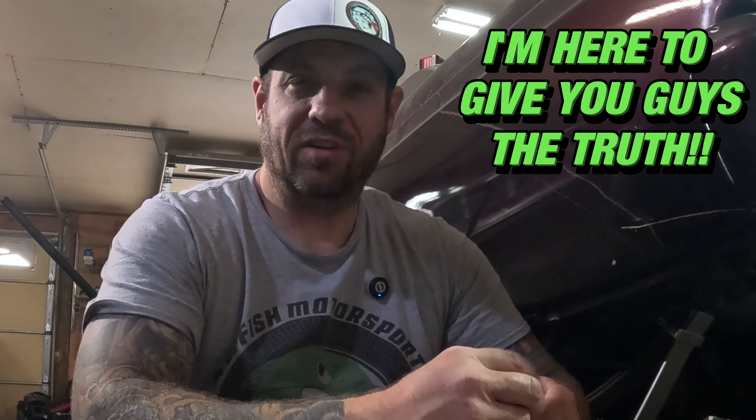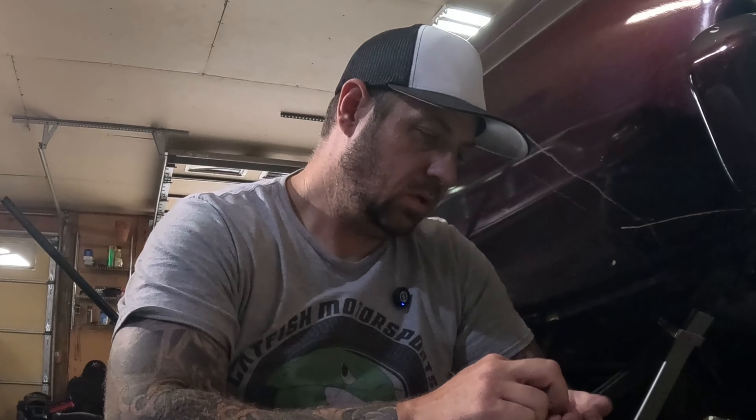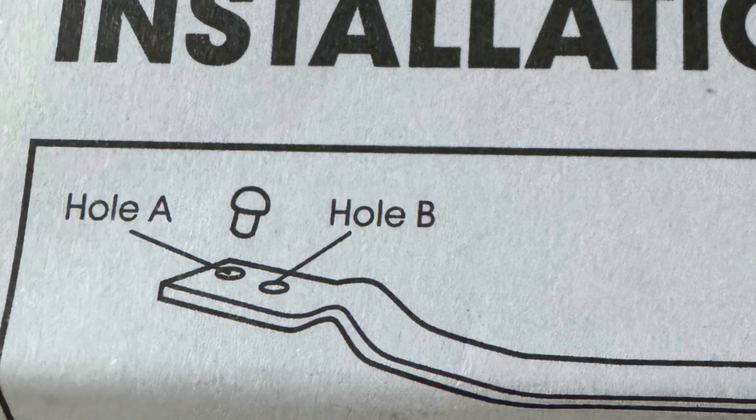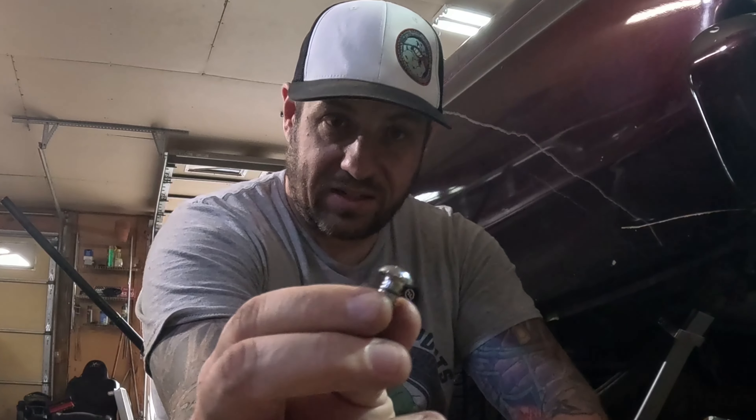This is not what I wanted to report, but I went and got some new grade eight hardware: a couple of standard washers and some hard lock washers. The bigger issue is that I don't think the rivet they give you is correct. It's a flat rivet and it just doesn't seem to be touching anything. If you look at the directions and the JEGS kit — even though it's discontinued it's still on their website — they both show button head rivets. I think they're shipping these with the wrong rivet. So I got two 5/16th grade eight button head cap screws to use in place of the rivet. It doesn't actually rivet into anything, so it should function the same.